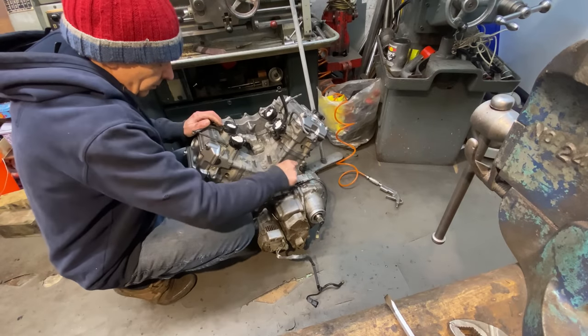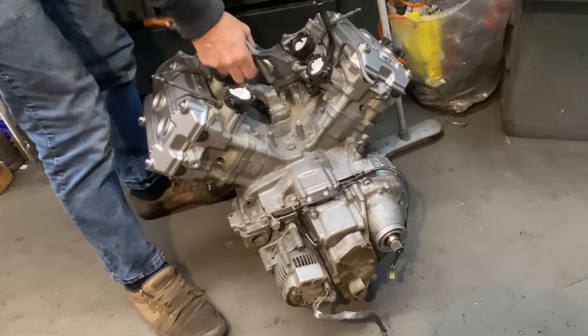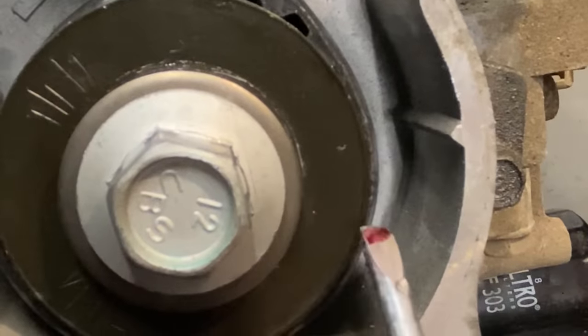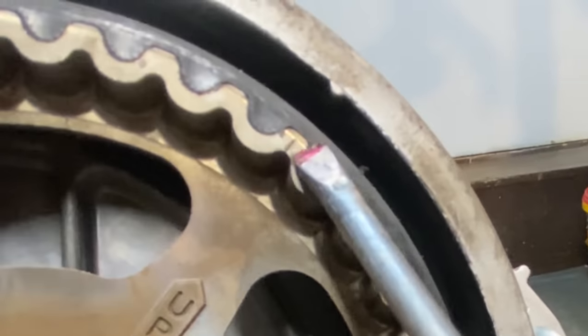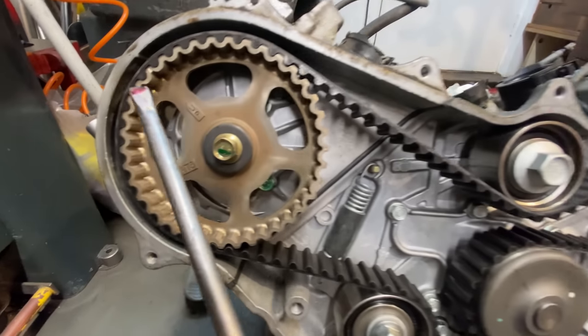I'm using a fine stainless steel wire brush to remove all the loose corrosion and oxide from the aluminium surfaces, then blow it off with an airline prior to stripping the engine down. The next thing I do is rotate the crankshaft until the dot on the crankshaft lines up with the raised boss on the casting and the camshafts both line up with their raised marks as well. When this is done the engine is set in the correct position for disassembly.